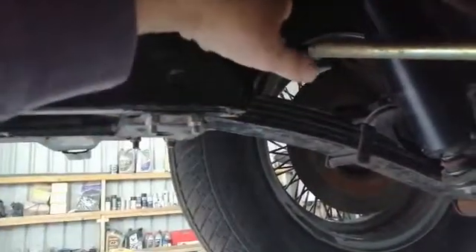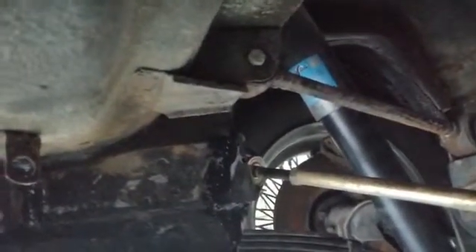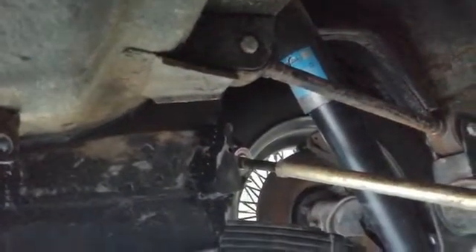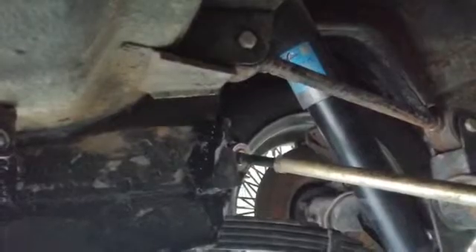The other thing is you need to just make a small L-shaped bracket at the top to seam weld in the top part of the bracket, because that's missing from the assembly but it was present on the original assembly before the car.